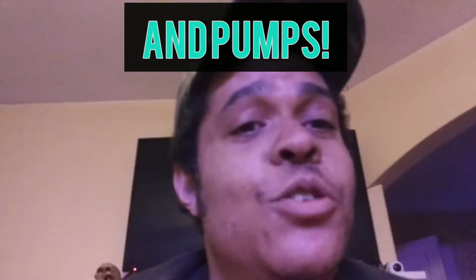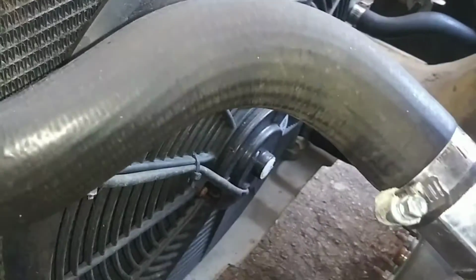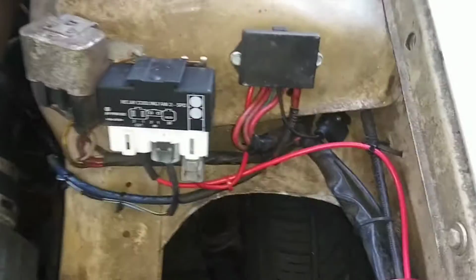I added the same relay that's made for a fan that I used, because they're like heavy duty. So I used the same heavy duty relay made by Volvo, and I used it for my fan. I have little clips for everything I'm talking about, but the fan, yet again, just like the fuel pumps, became extremely powerful. The ground was always okay because it wasn't very long, but it wasn't a thick wire, and it was probably longer than it should be. So the fan worked adequately for what I'm doing. But when I switched over to a relay, man, I'm telling you, it's a vortex.